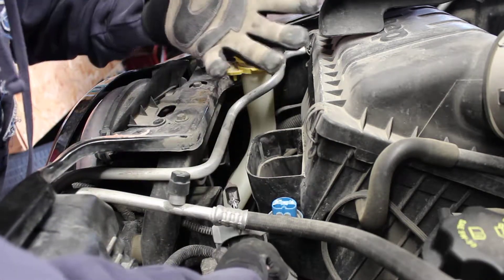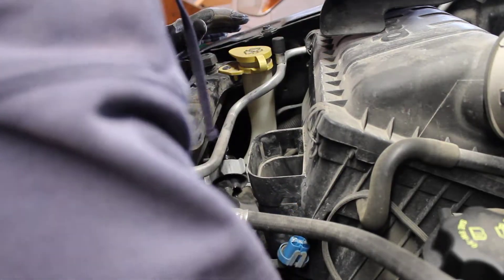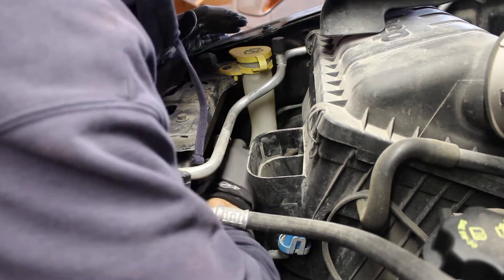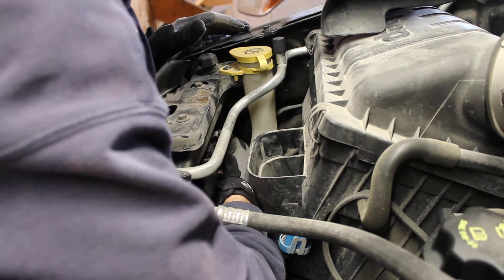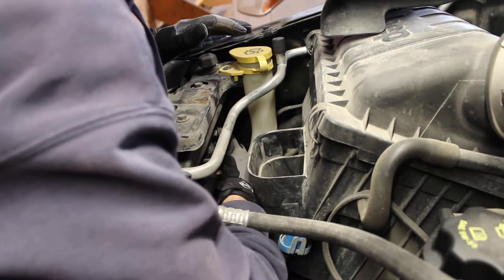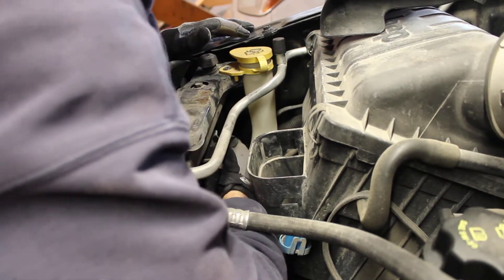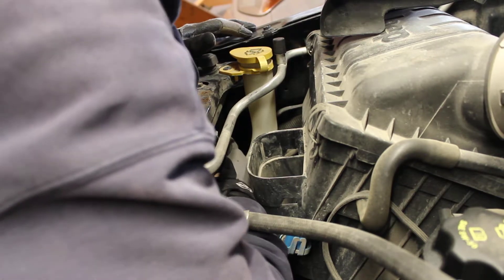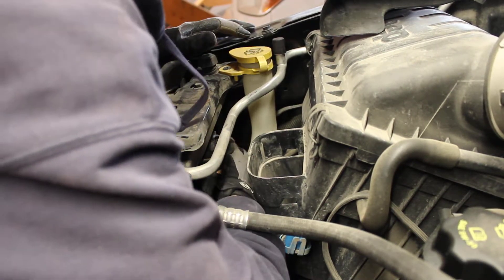Again, don't touch the glass with your hands — gloves are okay so you don't get oil on the bulb. Take your time here, it's a bit tight. Pop it in, find that position where it clips in — you'll hear it. This one is a bit tight to pop in, probably because of the new O-ring on it.